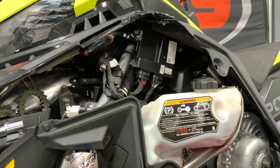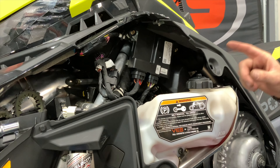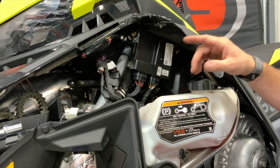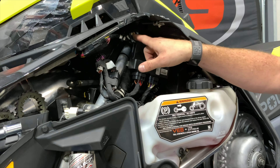Also, if you've ever been riding your sled and noticed your oil tank is not very secure — it shakes and wobbles quite a bit, especially when you're riding — this bracket addresses that. To prepare ourselves to install the bracket, we are after three things: one bolt, one nut, and we'll actually be temporarily removing the lid off the oil tank.